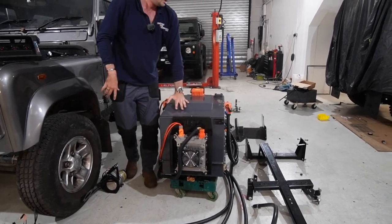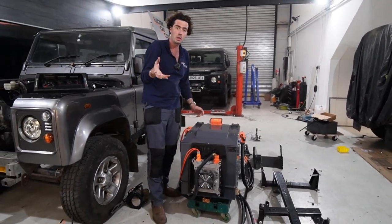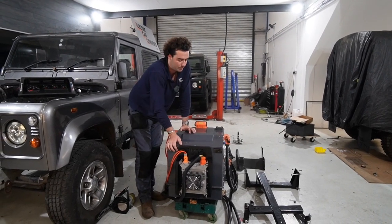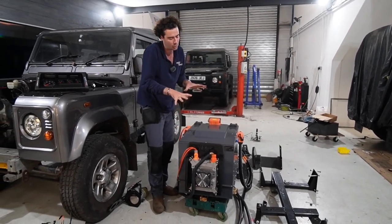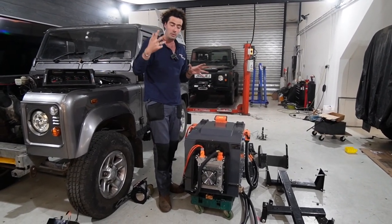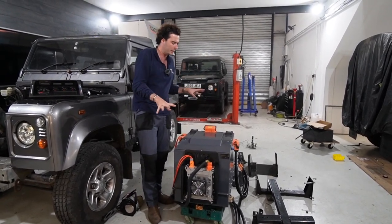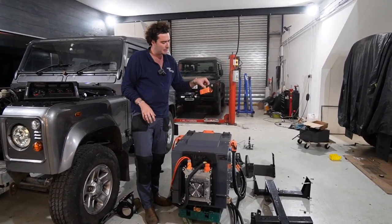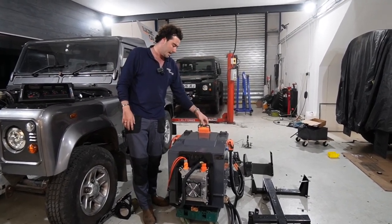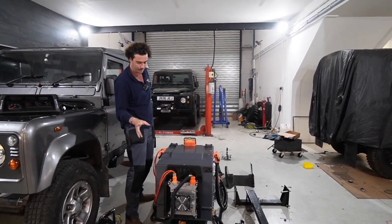Makes life easy. Inside the box are LG modules, which were destined for a VW ID series. So they're inside. And on the top layer, we've got the BMS. We've got the contactor circuit, contactor controller, CCS controller, all kinds of electronics in there, as well as your high voltage disconnect. So if anything goes wrong, like you crash or whatever, pull that out. So all built into the box, all safety tested and lovely.